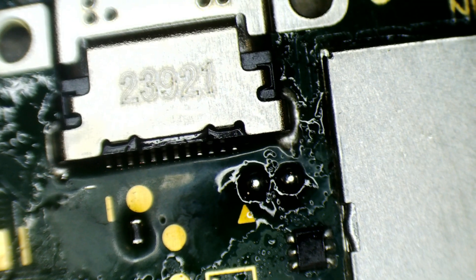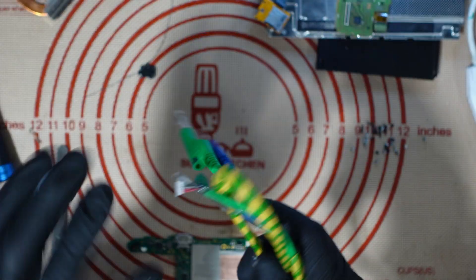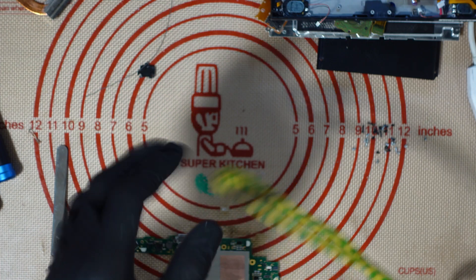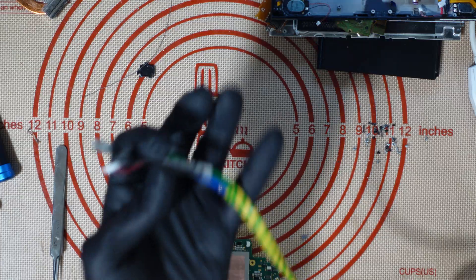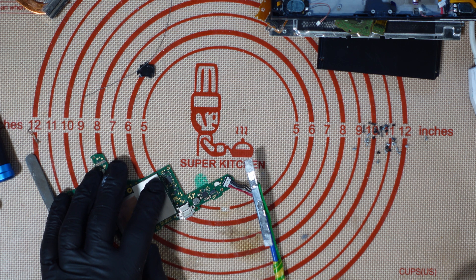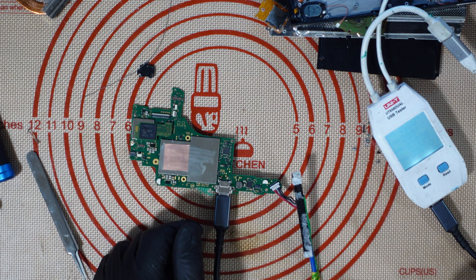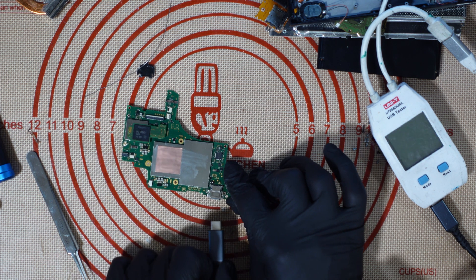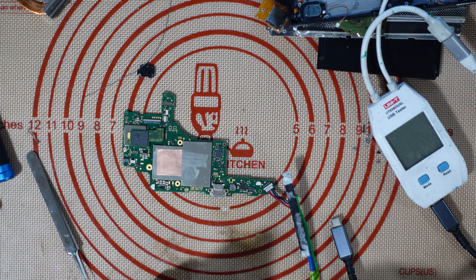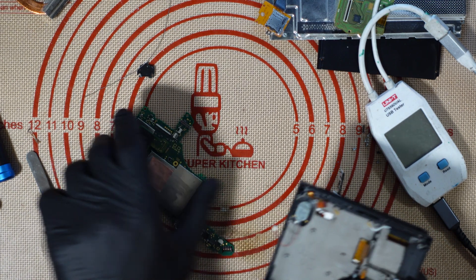Let's give that a test and see if we get any change now. I've got a bench supply cable here — this is basically one of these Nintendo Switch battery PCBs. I actually sell these custom-made to order on my website, and basically this replicates a battery for the Nintendo Switch and Switch OLED. So I plug that in, plug it into my bench supply, give it four volts, and then when I plug a charger in I've pretty much got a full battery. We get 15 volts, 0.09 amps — and do we get any current draw? We do! We get 400, 500, 600 milliamps, and that my friends is booting. I can tell just by the current draw there's nothing wrong with that charging chip — it is literally just a charge port.